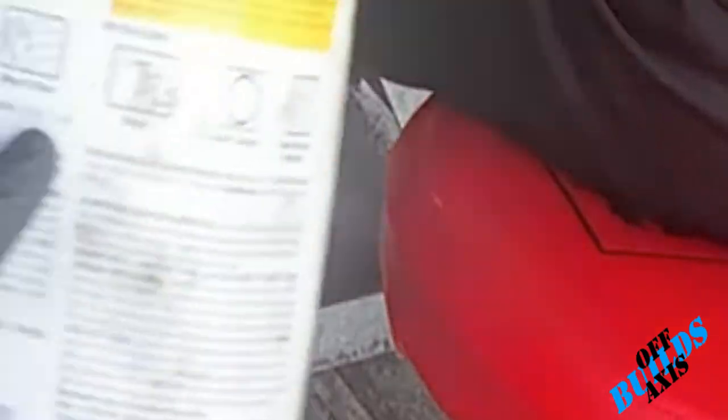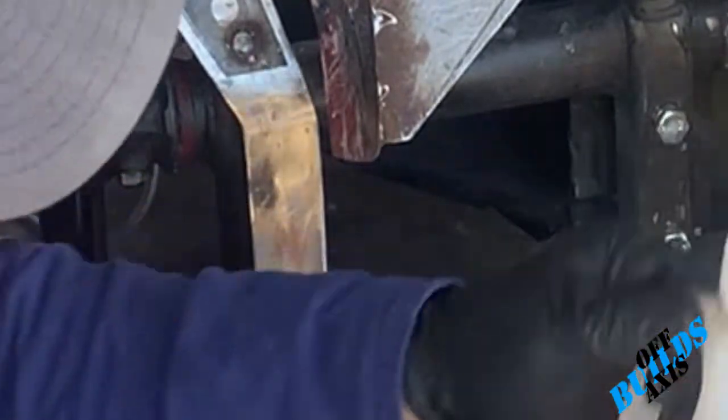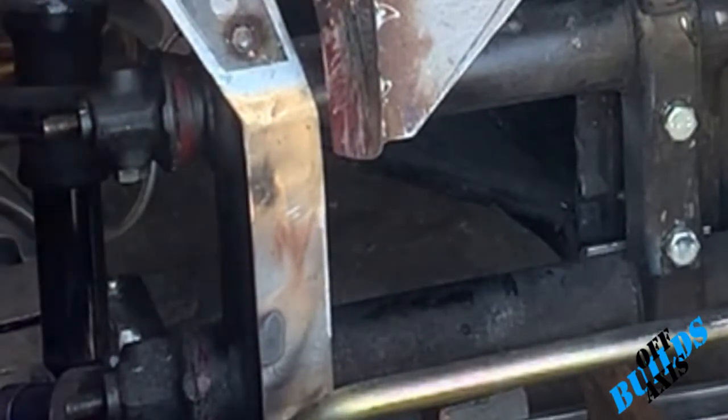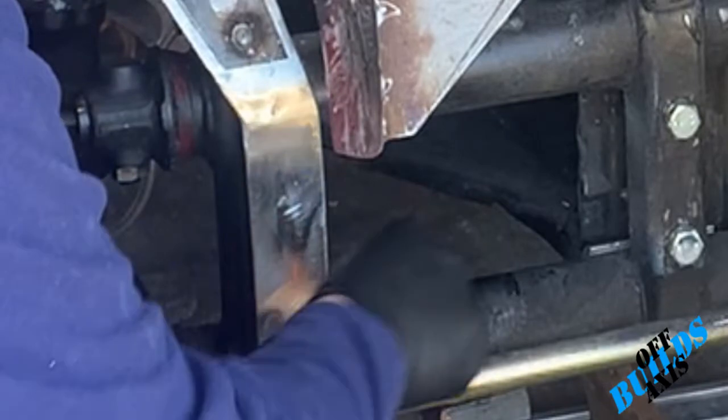So we have mixed, I believe we mixed it about 1 to 1. Yeah, they want us to mix it 1 to 1 for medium soils. You can mix that if you want to make it a little bit stronger. So I went ahead and put maybe about an inch or 2 at the bottom here, and then about an inch or 2 of water on top, okay? Just to dilute it down so it's not 100% citrus degreaser. So we're just gonna get the brush wet, like my son said, just scrub away.